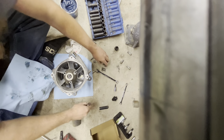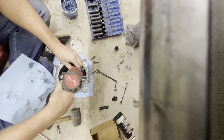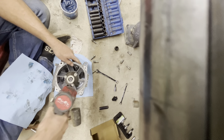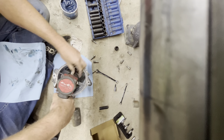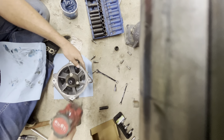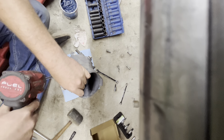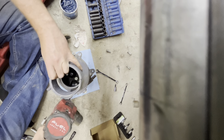I've greased all this — greased down in there — so that next time this has to be taken apart it'll come right out. I greased both sides of this rubber gasket. The first time I took it apart it was insane; it wouldn't come apart at all without tearing — just built up with corrosion. I greased it last time and again this time, and I greased each one of these mating surfaces too. On the other side I'm going to grease where that metal mates the other metal so everything comes apart easier later on.